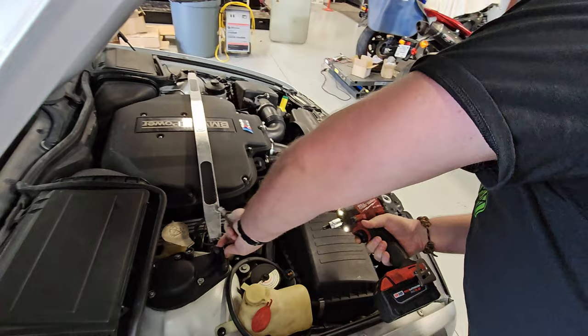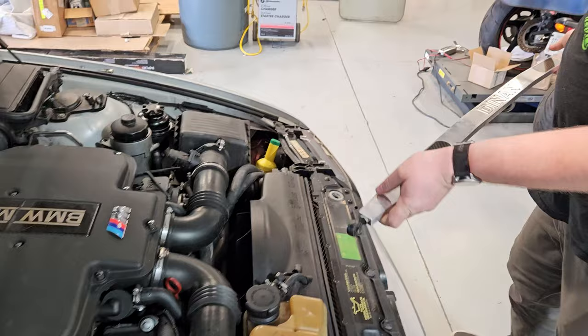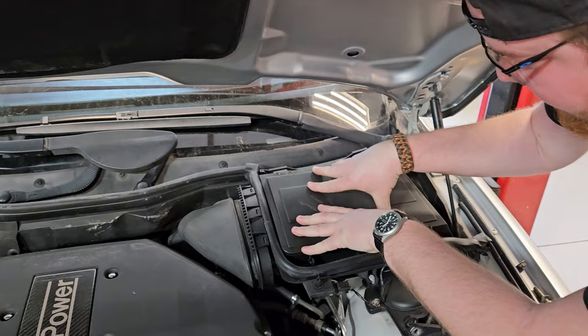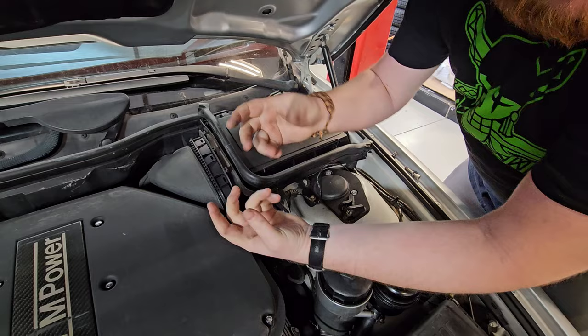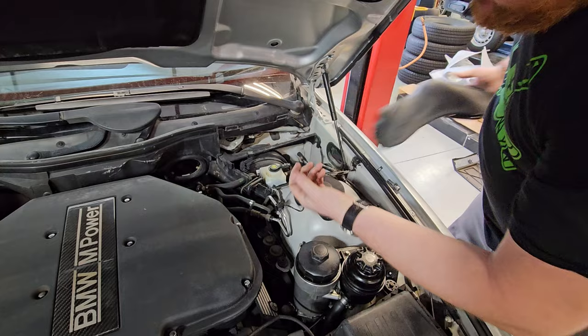We're not sponsored but we would love to be sponsored by Milwaukee, honestly. With these air boxes, if you have an E39 that is in fantastic shape, you have to pull these tabs and these tabs will pop this. You can also remove the seal if you need to. These are actually twisted into place — they've got three ears or teeth that lock into the sealed bracket on the firewall. Because I have an E39 and they're all like this, you can literally just do that.